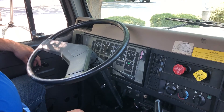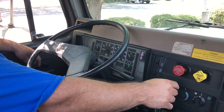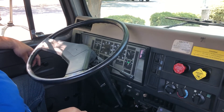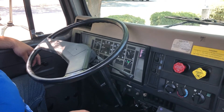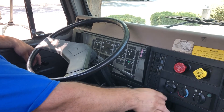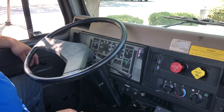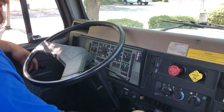I've got over 100 PSI, so I can now start my next set of tests. My first test will be my parking brake test. I'm going to release my trailer brake, put my truck into low gear, and attempt to pull away. I felt a tug on my parking brake and a tug on my trailer brake. I'm going to apply my trailer brake, release my parking brake, put my truck into low gear, and attempt to pull away. I felt a tug on my trailer brake. I'm satisfied with that test.